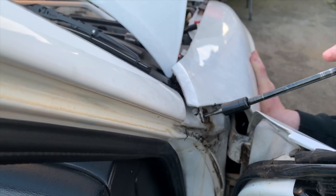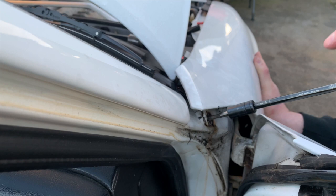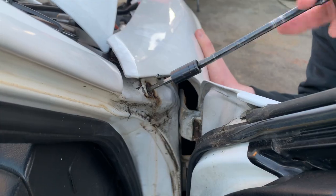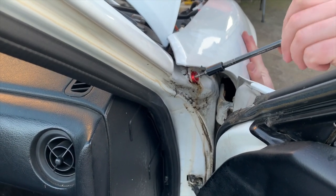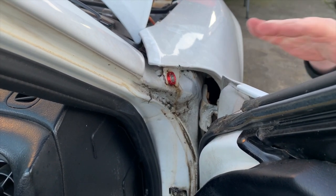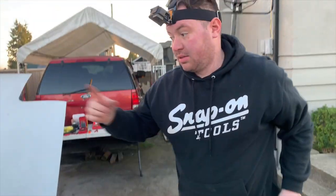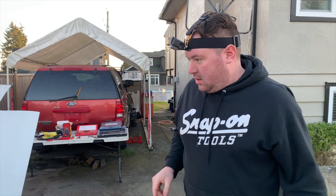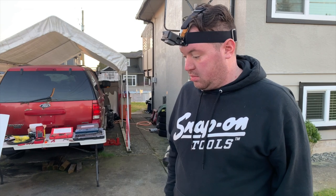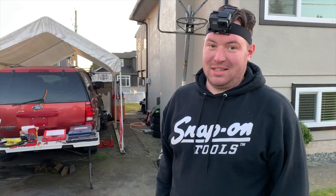Okay, so that, I think, is enough. We'll try a replacement bolt. So I think we're in luck. This side we were able to repair the threads of the original size, M6x1. The other side we did have to step up that thread pitch to the 8x1.25. That's pretty much how you repair a broken bolt when the nut is hidden and you have no access.